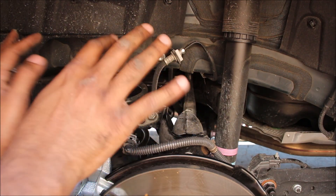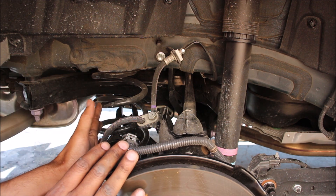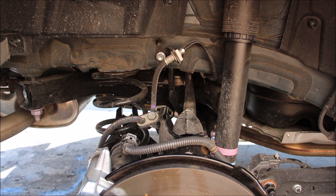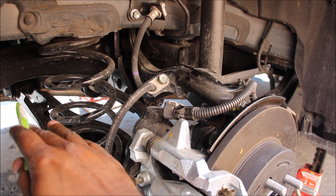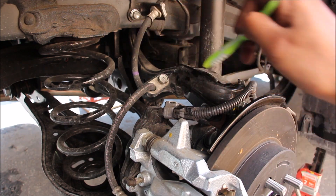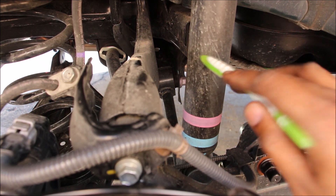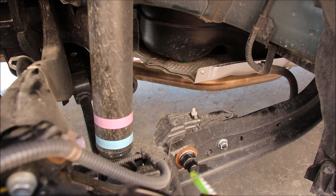The rear of the vehicle is where the TNGA platform really shines through, because it's now got a brand new rear independent suspension compared to the twist beam suspension in previous models, and this is going to offer better handling and cornering. We start with the spring attached to the rear lower control arm, with a toe adjustment over there. We've also got the upper control arm, which is this wavy one over here. On this side we have the front lower control arm, the shock absorber, and this control blade which acts like a trailing arm.